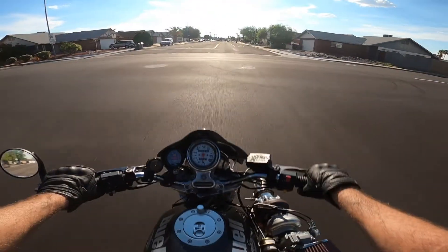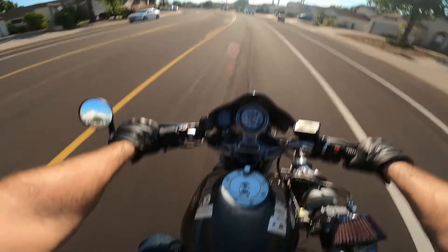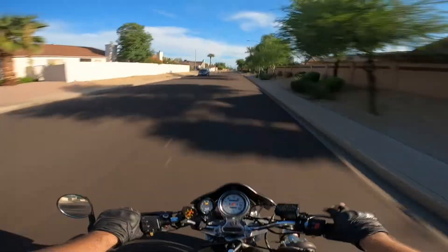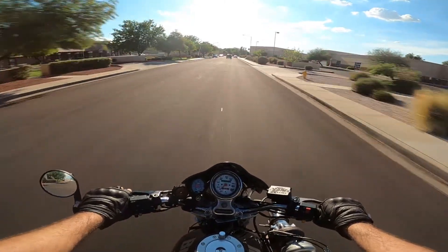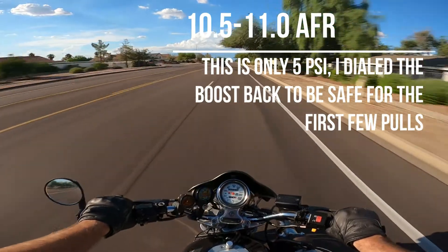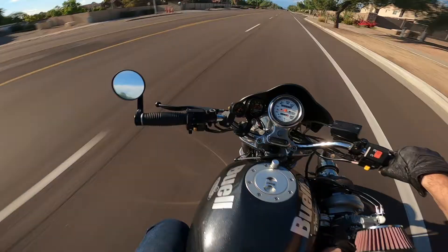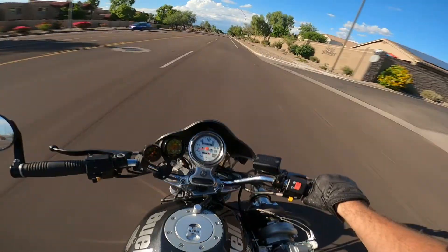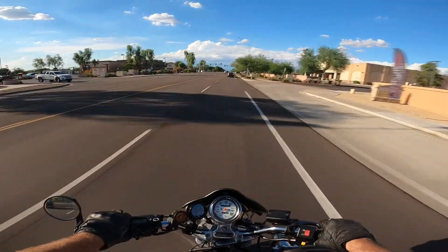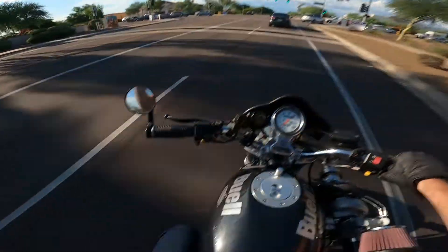Maiden voyage. So far it seems to be running pretty decent. The pilot's on the rich side, but that's all right. During cruise, we're at like 12, which is too rich. Seems like the idle's a touch low, but the bike's not completely warm yet. The AFR slipped into the tens, so we actually need to lean it out. And here's what's so cool about running the thunder jet — I'm going to adjust this while I'm just cruising down the road. I'm going to turn that in like a quarter turn, put the cap back on, and boom. Now just imagine if we had to manually adjust the main jet every time we needed to make a change — that's why people hate jetting bikes so much. With this, you can jet it while you're riding it.